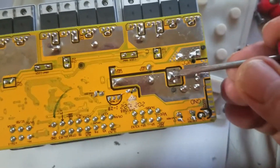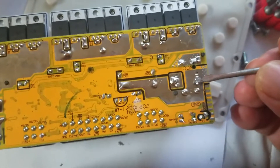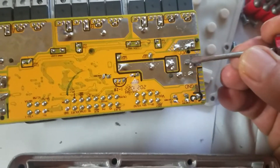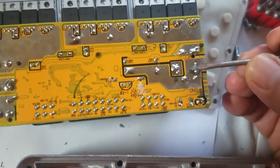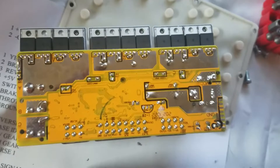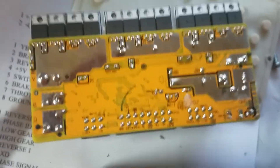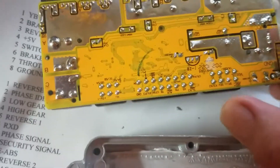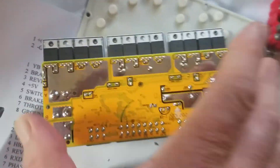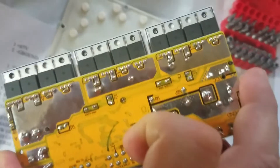What you do is get a thick piece of wire and solder it underneath the board between the two shunt points. What a shunt does is create a voltage drop between two points, and that voltage drop is relevant to how many amps are being pulled — so the electronics can read the current. If it sees too many amps, it cuts power. Soldering a jumper wire hides the amps going through, fooling the controller.